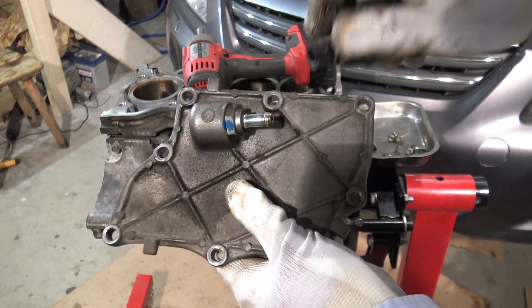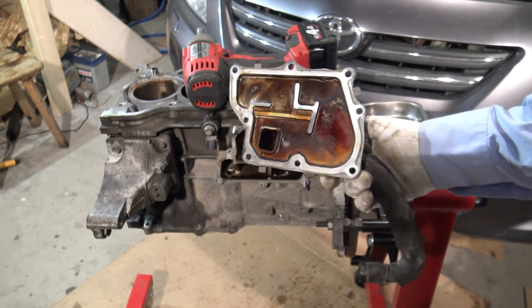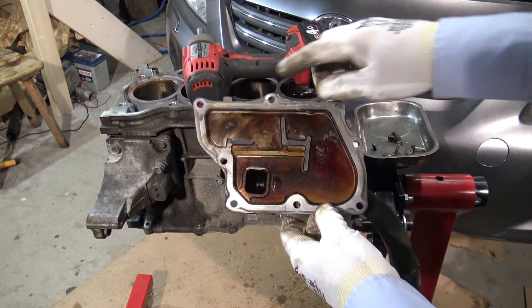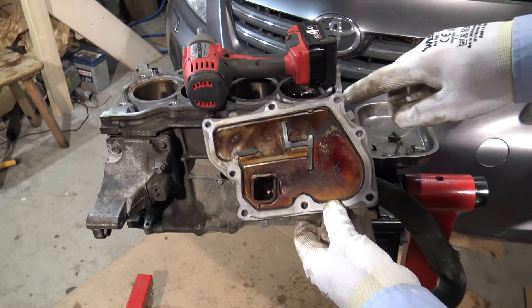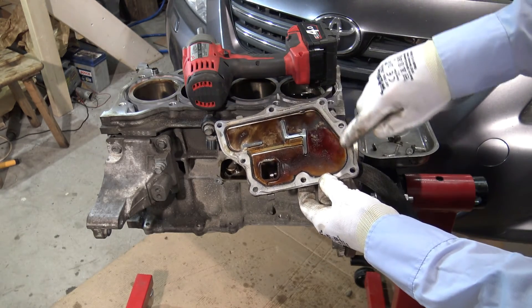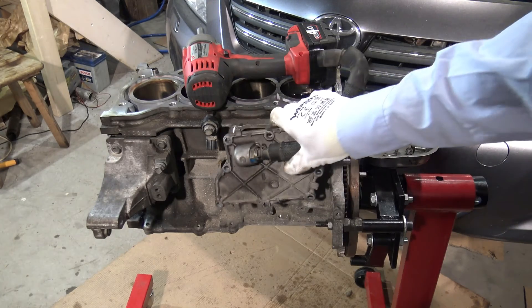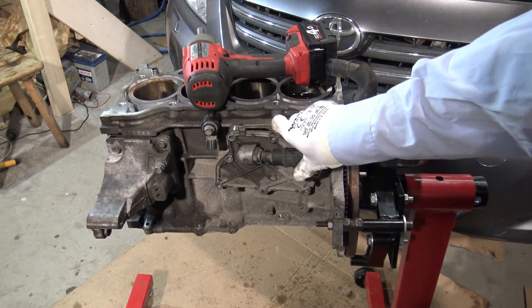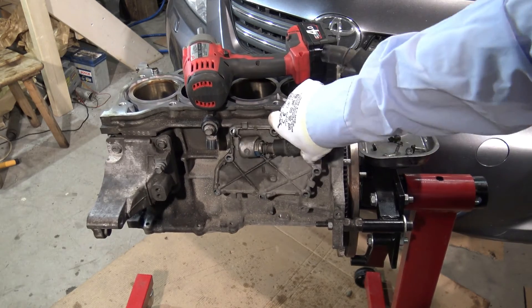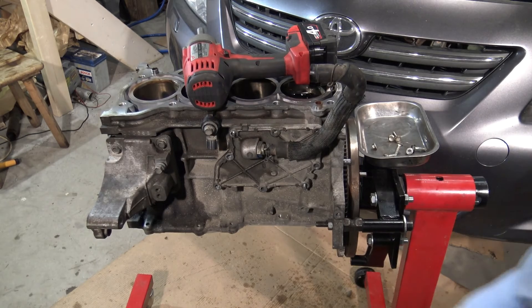Now I take this part away so we can see the valve better and what it looks like, and then I insert the hose back. That is the ventilation case. When installing the cover back, remember that there is sealant glue in that area — you have to insert new glue there. Thank you for watching this video!